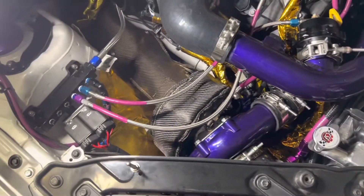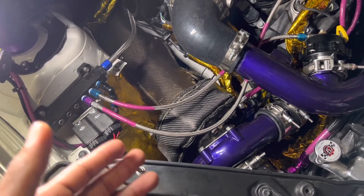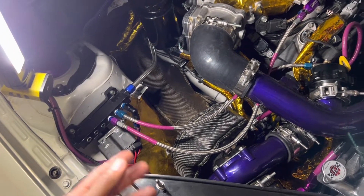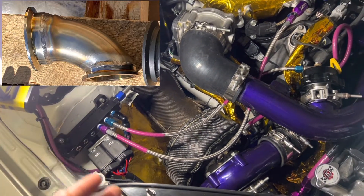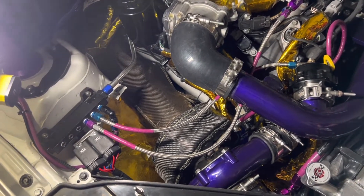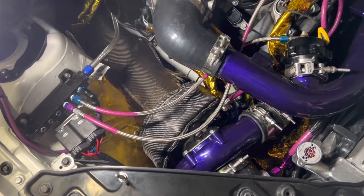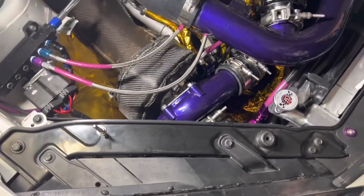That gives you a good overview of how to properly set up your Omega Series turbos. Everything else is basically the same — we've moved to a V-band turbo mount bracket, but it hooks up essentially the same as the old T4 mounts on the ON3 turbos. The V-band in your kit is two and a quarter inch — that's what hooks the turbo to the V-band turbo mount bracket. The other side hooks up to the up pipe with a two and a half inch V-band. Same clocking of the turbo, same oil drain, new oil drain flange but that's the only one in the kit. The new Omega series also have a little more clearance between the back of the headlight and the compressor housing, making fitment slightly easier.